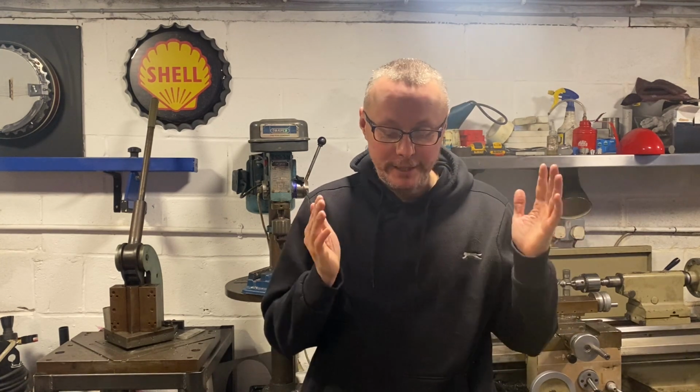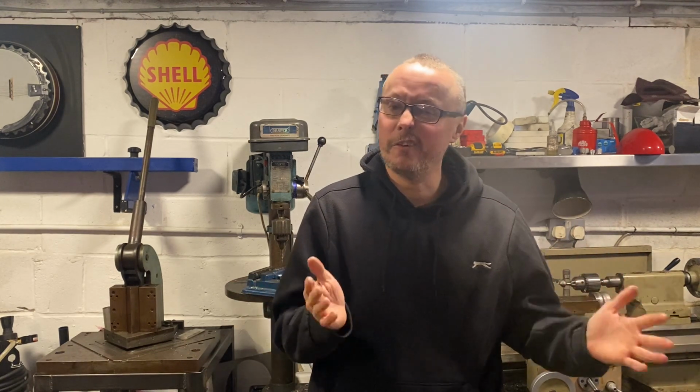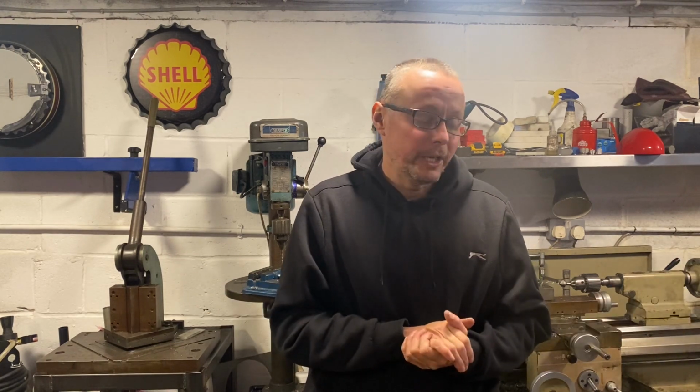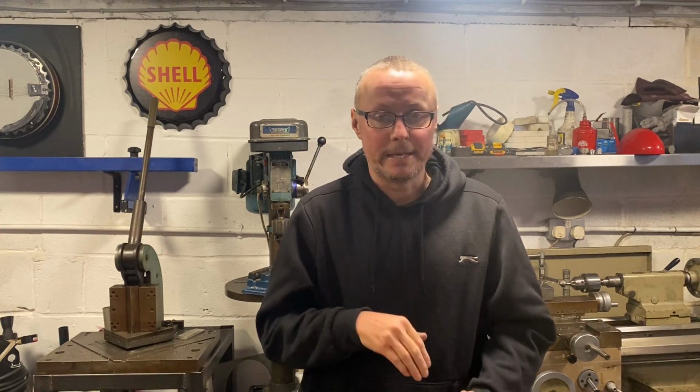Looking with a tape measure, the physical length of the actual engine is near enough the same. It's obviously four cylinder, they're near enough the same, most are. But the issue we're seeing is the gearbox. The gearbox on the Honda engine is quite a large bell housing. The gearbox on the old 1.4 16 valve is quite a small bell housing.